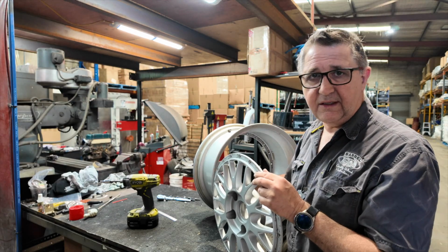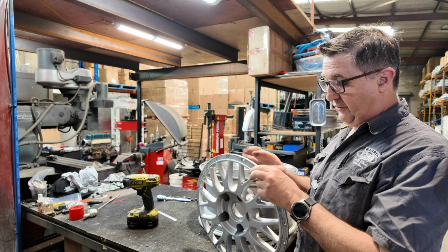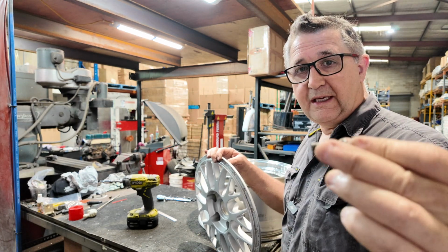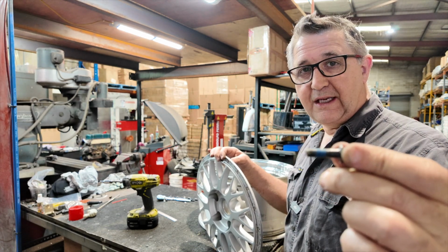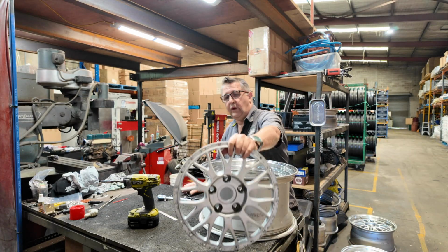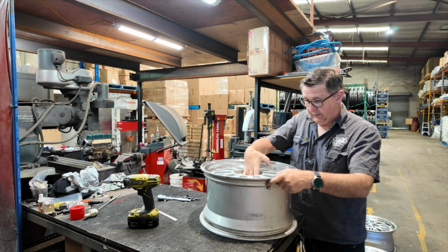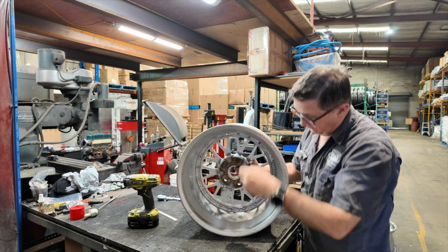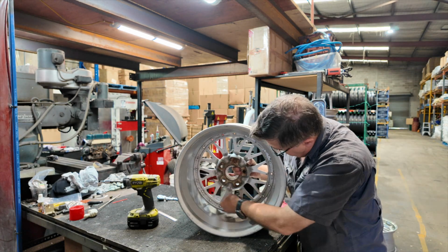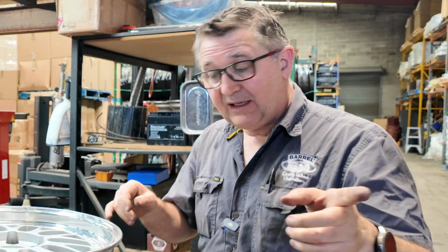You can't feel any bending there, mainly because this wasn't done up tight enough and there was no Loctite on them. You can see where the original Loctite has been, and you can see that it's bare on the end where the nut's been taken off and nothing's been added. So when these are put together correctly, there's no movement, and there's no movement because there's no gap. See, that's a tight fit. There's absolutely no movement there whatsoever, and that's how it should be.